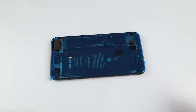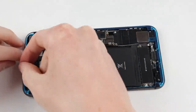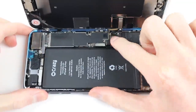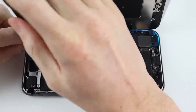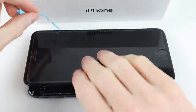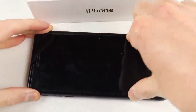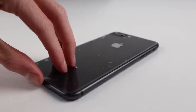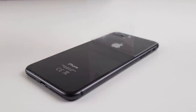Now that I've placed the battery into the iPhone I can finally install the water resistant gasket which will help stop water and dust from entering the inside of the iPhone. To make the display installation a little bit easier I only removed one half of the plastic film for the waterproofing gasket. The reason for this is it allows me to be able to connect up the display and install the brackets without getting the gasket in the way and becoming stuck on the display before I install it and seal it down. With the cables and connectors installed I can seal down the display and install the two pentalobe screws in the bottom, and remove the plastic films from both the back and front and install a tempered glass screen protector.